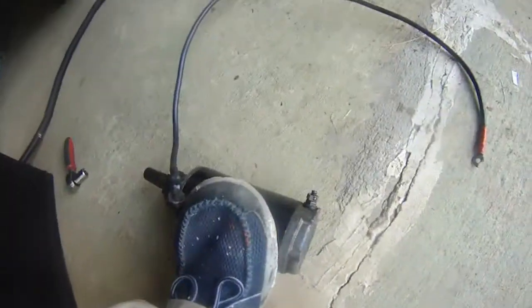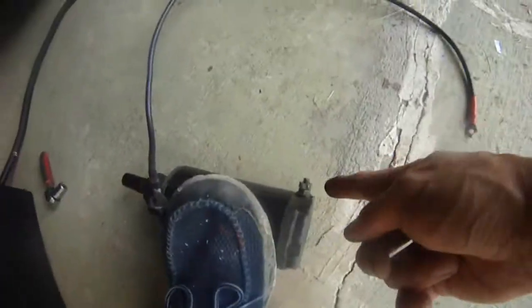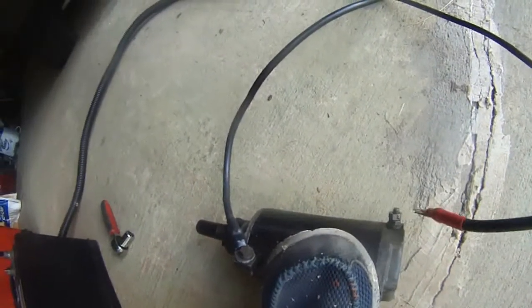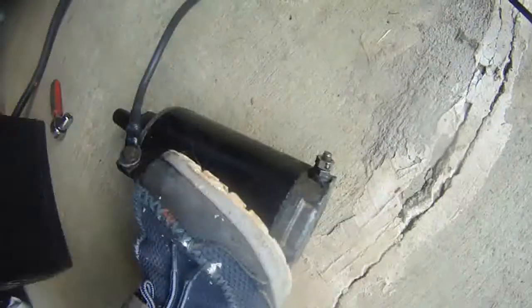I think I may have just fried this, so I have to open it up again. I'm going to test this again. I have the positive red going to the red terminal, which is the positive of the starting motor, and the black wire to the black, which is the negative. I'm going to jump this starting motor, hopefully it will turn. Nope — shorted it. I have to open it up again and fix it. Stupid me — I accidentally touched it.